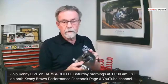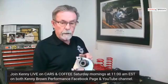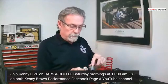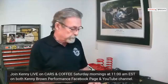Before this, in AGS2, that's my Advanced Geometry Suspension system, we had what we call fixed strut, and we actually used the onion heads from the SVT Mustangs and moved them all the way back, and then we just came out with this, and so it's nice and quiet. We use urethane bushings, top and bottom, instead of a rod end, because it kind of dampens some of the NVH: noise, vibration, and harshness.